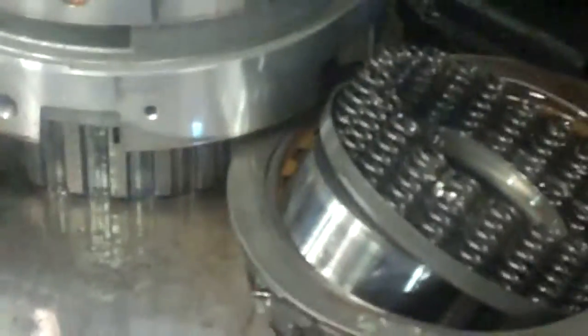All this metal went through the whole transmission and everything was okay, with the exception of all that metal being embedded into the clutches, which will have to be replaced. But all that metal is coming through this torque converter, which has actually failed — and this is where all the metal is coming from.